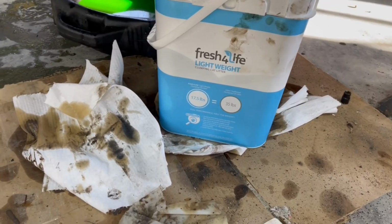So we're getting ready to go under the Yugo and get these axles out. Far, far better setup as far as I'm concerned. It's a little bit different. The inner axle or CV part is held in with three 10 millimeter bolts. So you pop those bolts off, they're easy to get at, and boom, the axle just pops out of the seal. And that's how you drain your transmission fluid all over the floor again.